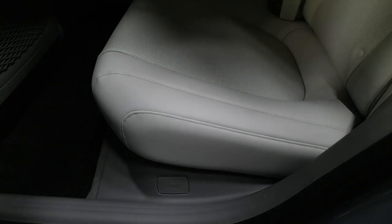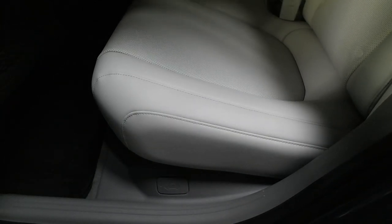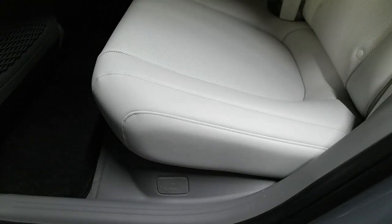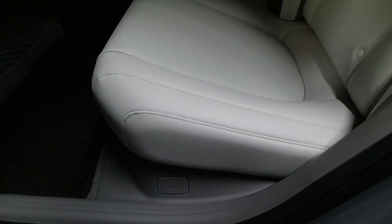Okay, so now that the battery is unhooked, I'm going to be removing the rear bottom seat cushion. And the reason for that is where the amplifier is going to go. That's where the factory one goes. There's a ton of room. So I'm going to remove that. Now, personally, because I don't like to be curled up in the back of a car, I always start with the amp rack and all of the associated wiring and then just run wires for it. I find that to be the easiest way for me. Whatever way works for you, you can do it.